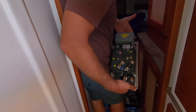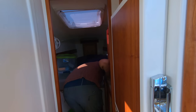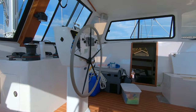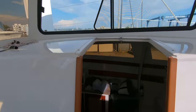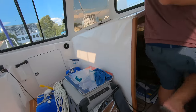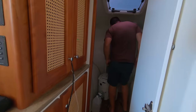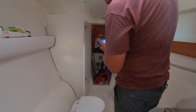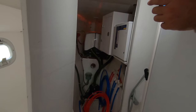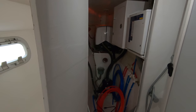The motors on the ground are controlled by these boxes — a Kelly controller with some canned stuff and a relay. That does the brains of the motor, like an ESC — same function as an ESC for a remote control car, but a little more advanced, with more data outputs. And then there's a 3.5 kilowatt AC generator. If you had a big charger inverter, you'd be able to run it pretty much indefinitely off that generator. We're replacing that with a 6 kilowatt 48 volt DC direct generator to make this a more powerful hybrid setup.